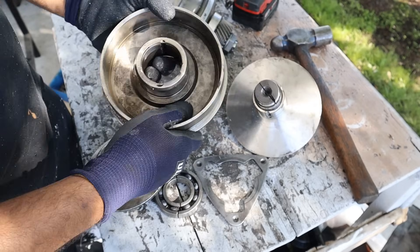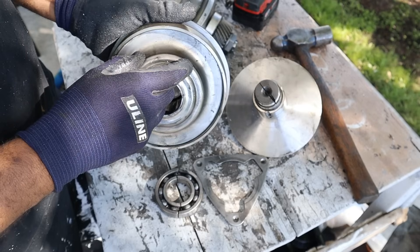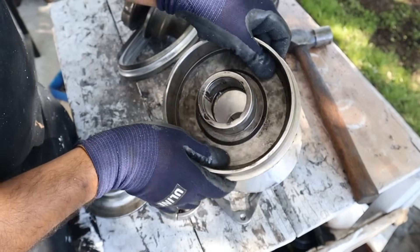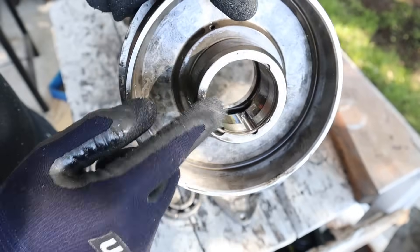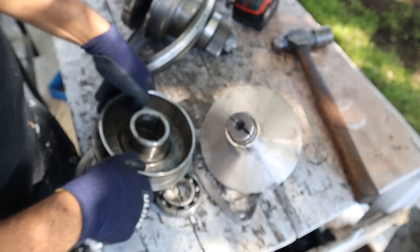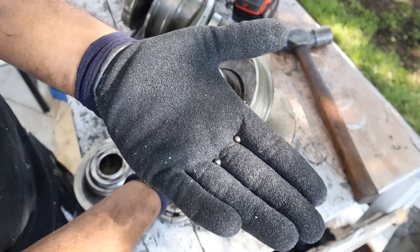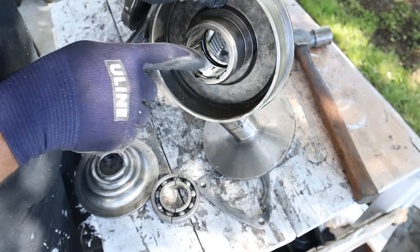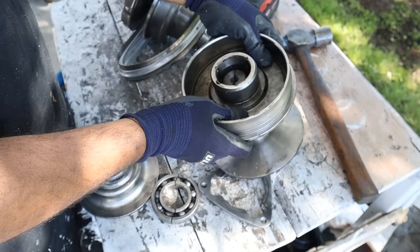Sitting behind the sliding piece is this piston, which goes inside here and seals against transmission fluid. Because this needs to hold a rotational torque, there are actually three keyways machined inside of this variator housing as well as on this variator shaft. These little balls or debris that fell out were what's wedged inside of the keyways to clock this and prevent it from spinning.